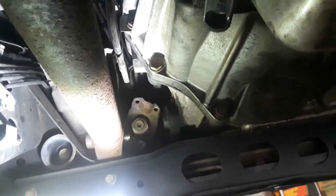Let me crawl up underneath this thing — it's not easy, just to warn you. Unless you can somehow slide that neutral safety switch past that driveshaft right here, I couldn't get it past. There's a little shaft there — your neutral safety switch slides down this shaft, and once it gets so far it binds up on this axle. So you've got to unbolt that driveshaft. That's what I had to do — unbolted it, finagled the switch out, and put the new one in.